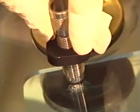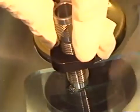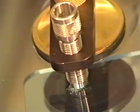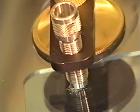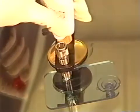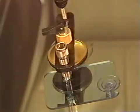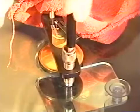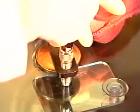Keeping the bridge level, position the injector base by sliding it directly over the impact point. Be careful here to ensure that no suction cup lubricant contacts the resin or impact point. Insert several drops of resin into the injector base, either by dripping it directly from the bottle or by using the UV blocking syringe, and then insert the injector press.